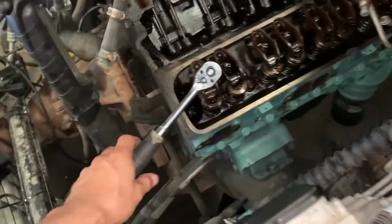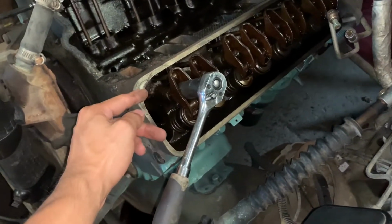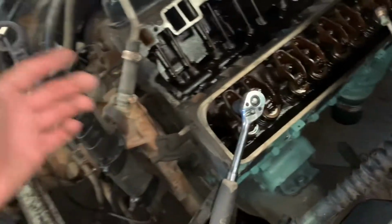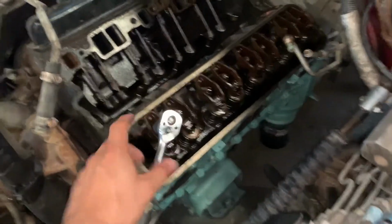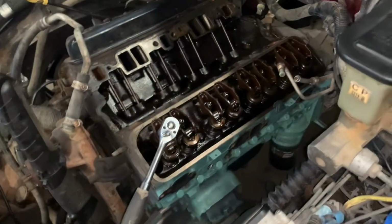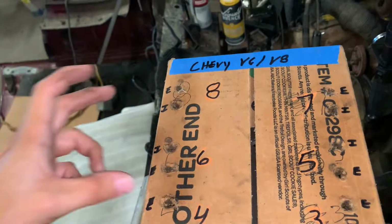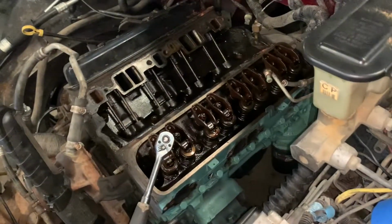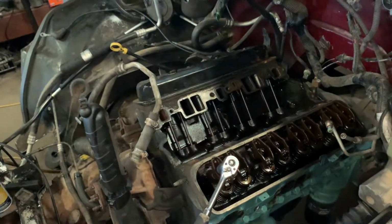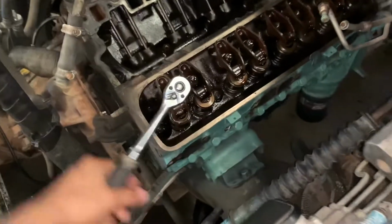So, like I said, it's a 16 ratchet. Just take these off. Inspect. I cannot stress this enough: inspect the actual studs. On the old Vortec 350 I had, the one that's on the channel, that I sold, when I did a head gasket job and put everything back and did the valve adjustment, somehow it pulled a stud on bank two, on cylinder numbers 4 and 6, both on the exhaust valve. Because I put headers on, and those two ports were still black while the rest were already burnt off the paint, so I knew they weren't firing. Sure enough, the rocker was pulled out, the stud, so of course it's not going to open. Intake, but no exhaust, so it was backfiring too, coming back through the intake.